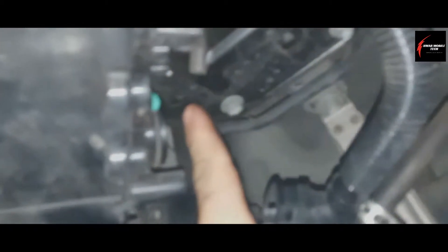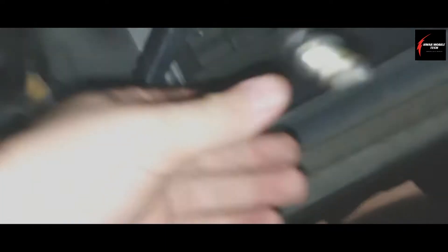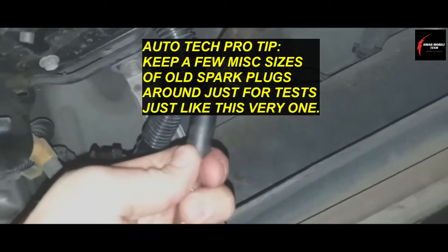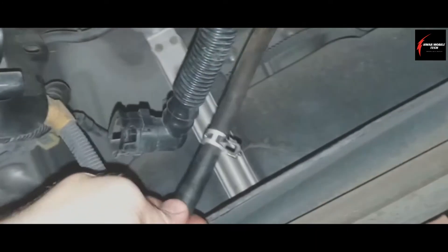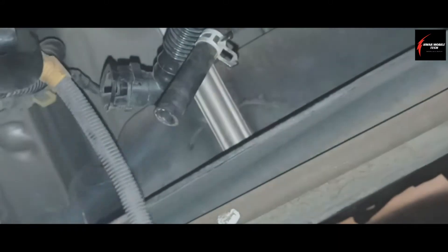This is how I know I've got the right hose. Here's the EVAP canister right here, and this hose just plugged in right there. I've got smoke coming out and I put a spark plug in the end — it's really good for plugging off open hoses like this. You'll just wait a little bit, and how you know there's no leak in that section is that as soon as you pull it out, you can hear the pressure release. So I know that system is good.